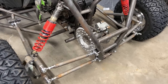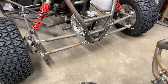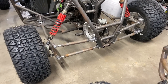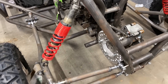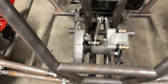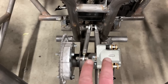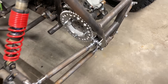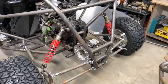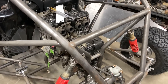Here is a trailing arm setup. Some say this is easier but I found it pretty difficult in itself. There's still plenty of adjustment, but when you adjust that way you're bringing your toe in, so it's kind of a one-time setup. You can see I've got the spacer run for chain alignment and I'm using both bars - I'll use two separate tabs so they both run straight. I've got the axles pulled so you can see how easy it is - once you pull those four bolts they just slide out. That's a 1200cc engine, about 150 horsepower, though it redlines low being an older bike engine.